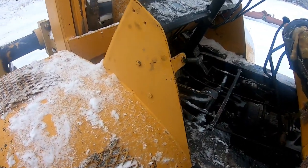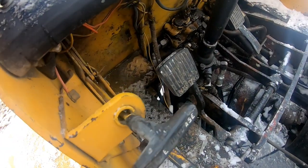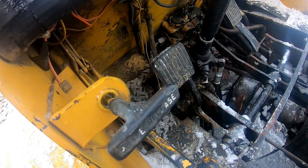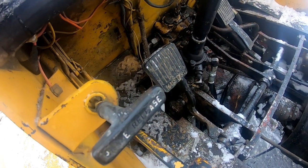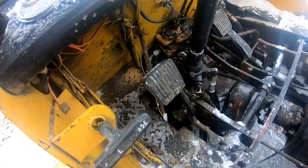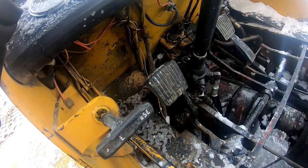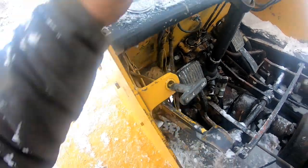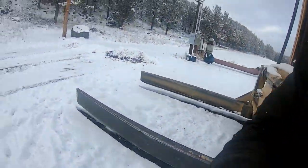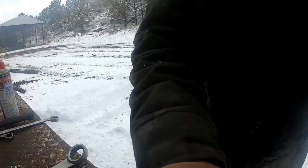So I don't know if there's a check sticking in here or a shuttle valve somewhere in that valve block. It's hanging up. I thought maybe the spool was sticking because it was so rough. There's obviously something else going on here in that valve block. It's worn out, what it is. Well, I'm going to pull it back under the barn over there.